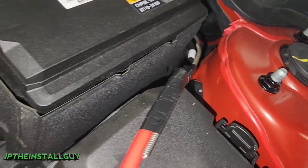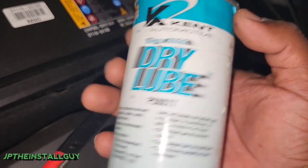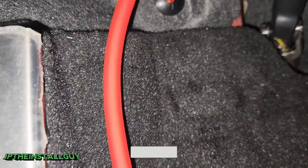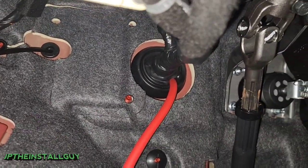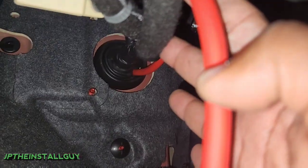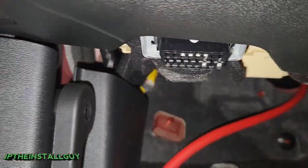As you can see, we got that taped up. Used some Kent Automotive super slick dry lube — got it on my finger. Just so you don't see any red wires coming from that part going up there, we are going to split loom now. One thing you could do if you wanted to: you could split loom this thing and then zip tie it along the top here so nothing actually drops down to the floor, then maybe bring it over the top of some of these wires and come through the back side.